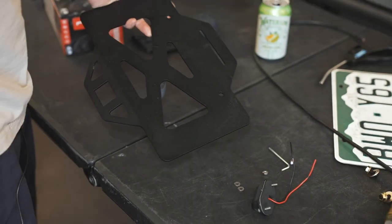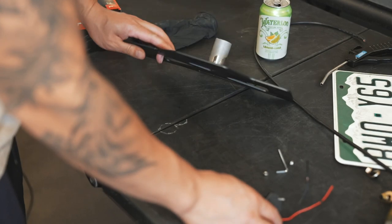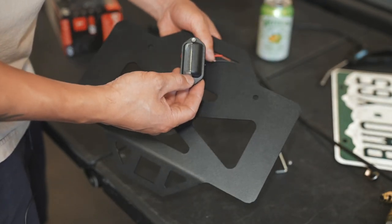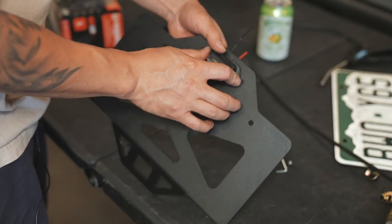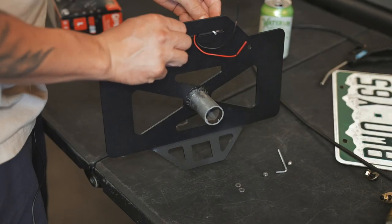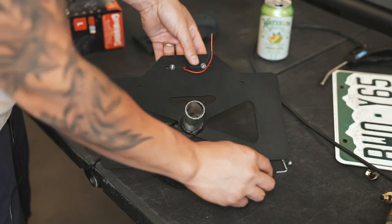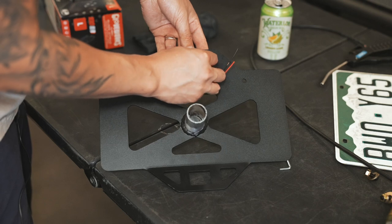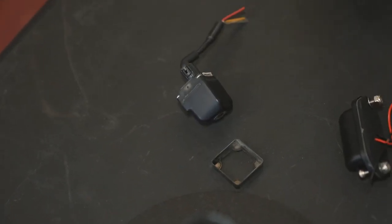On the outside here, we're going to test out the license plate light real quick. I have trimmed this back with the razor, strip a little bit of wire off here. Now I'm just going to go turn the truck on and then touch these pretty much and make sure it turns on. So we have just turned the license plate on — connect these real quick, just touch it and make sure it lights up, and it does. Off, on — so there it is. Now that we have verified that it works, we'll go ahead and install the license plate holder and show you guys how to connect these.